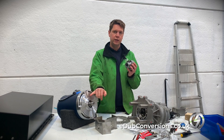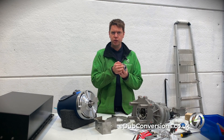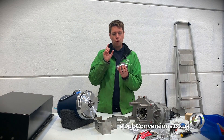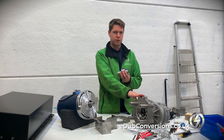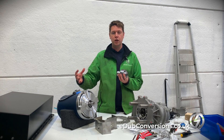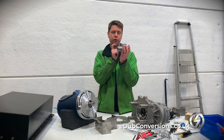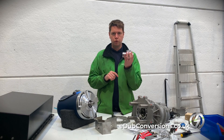On the other side, it's a key-held piece, and we've had to manufacture this piece. The splined half was available off the shelf, so we found that piece and got it shipped to EW HQ, then took measurements off that to build the mount on the far side. What's really great about that is if we want to use the same single speed reduction gearbox in any future builds — which we almost definitely will — but with a different motor, like a Hyper 9 or a Zonic high-voltage motor for rapid charging, then all we need to do is adapt this half of the coupling rather than the whole thing, which saves a ton of money because the milled piece is very strong and costs a lot more than you'd expect.